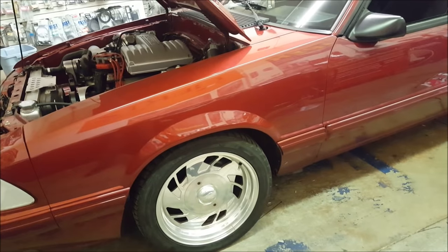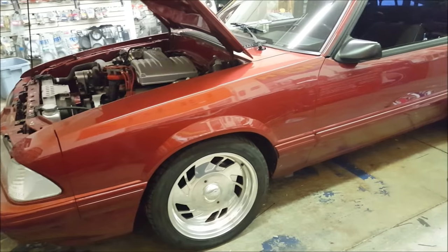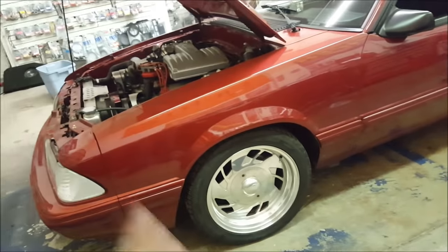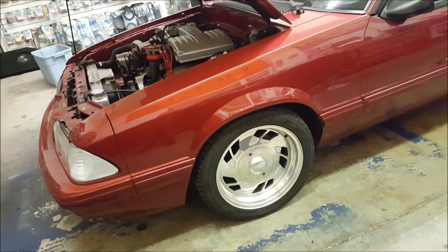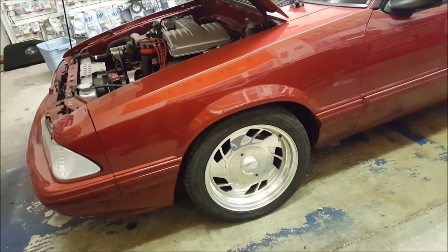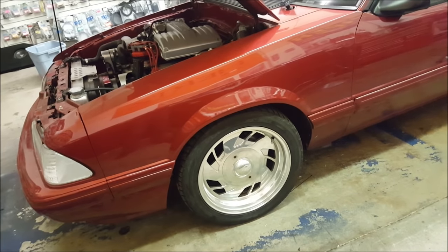This car has a four-wheel disc conversion and it's switched over from four-lug to five-lug. If any of you own fox body Mustangs and plan on making a handling car out of it, you need to do the five-lug conversion and put rear discs on it. Even from factory, if the five liter is healthy, it has so much torque — I don't understand why they put the tiniest set of brakes on it with only four lugs on the hub. It needs to be beefed up right away.